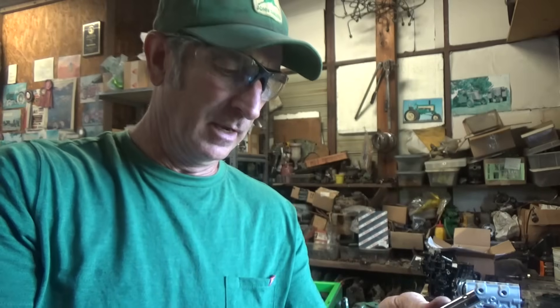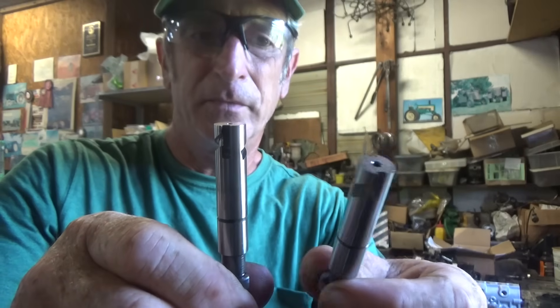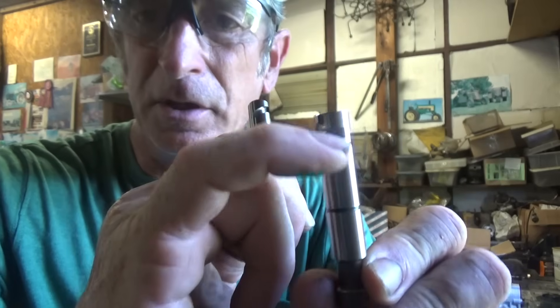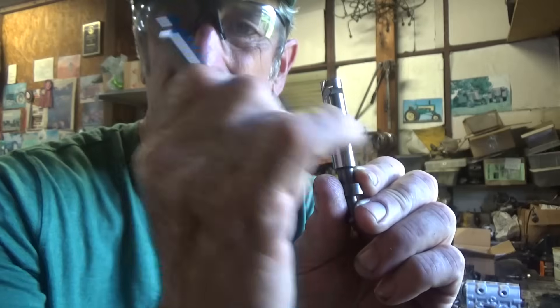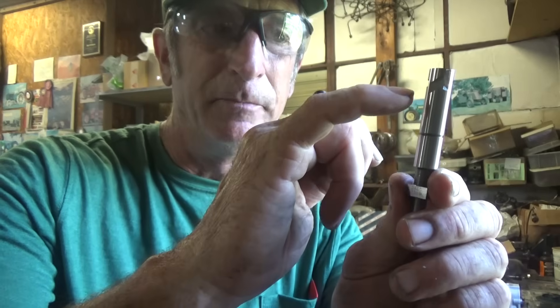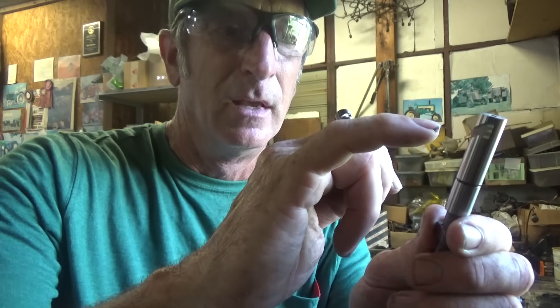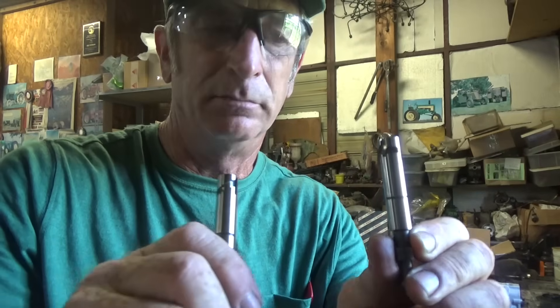The manufacturers - I guess I don't know why - nowadays stock ones they try all kinds of tricks to keep you from getting maximum fuel delivery. These are exactly the same diameter - one's a high performance and one is just a stock one. The main difference is the stock one has this notch cut right there. See, this doesn't have that. That notch going straight across keeps you from being able to get maximum fuel delivery, because that notch is cut in such a way that if you try to turn your fuel up past a certain point, it will register with that hole in the barrel and spill the fuel pressure out.